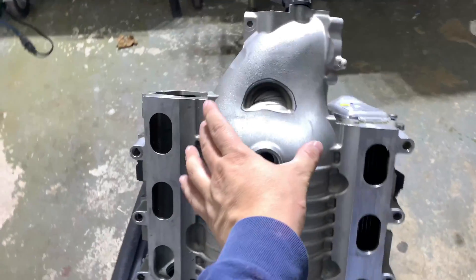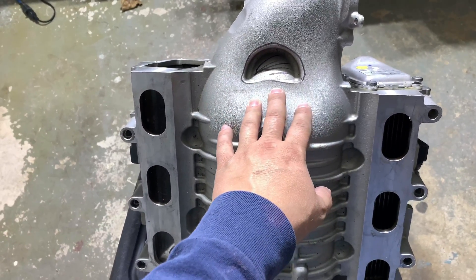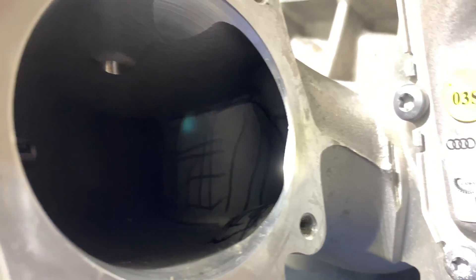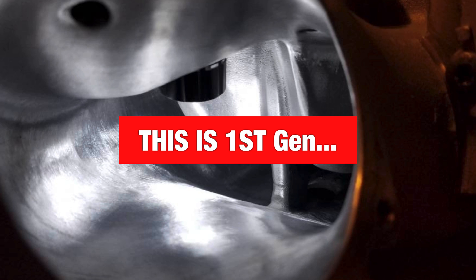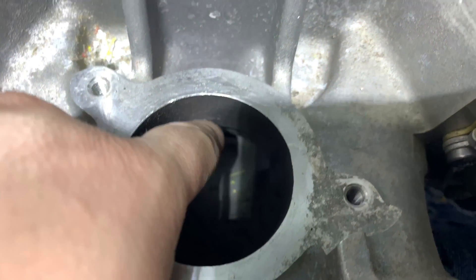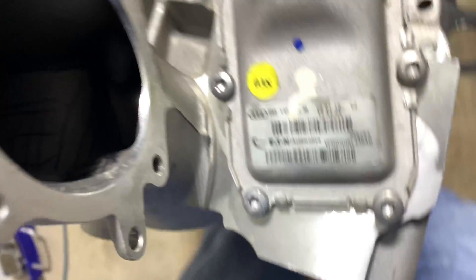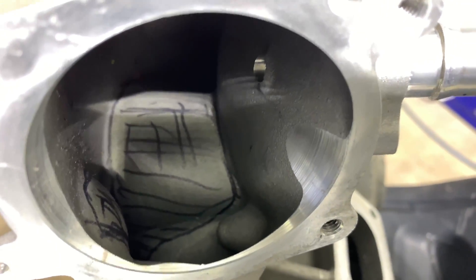So this old inlet over here is for fresh air coming in. We have a bypass, and this is the first big difference in this particular model — the bypass wall. It's completely closed, so all the air returning from the supercharger flows right through here and out inside the compressor area, which gives us a really big restriction in airflow.